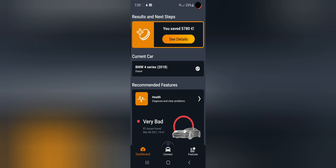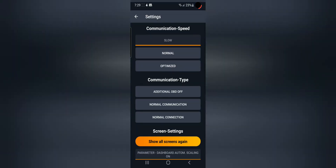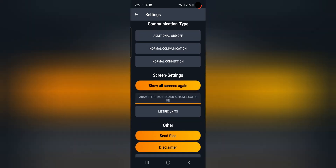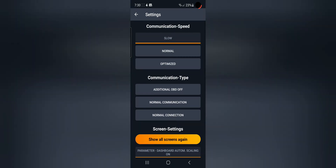This is how to go into your options and change the settings. Scroll all the way to the bottom, go into settings, and set the connection speed to slow. Also set the mode to expert mode. As recommended by Carly, with these settings you can code the car better. Every time you code the car you need to repeat the cycle.